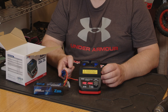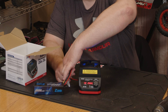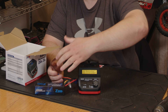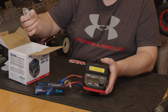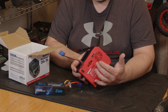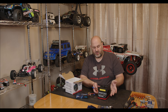In stop mode it'll keep the fan running as long as the battery is connected until it cools down. Once it's cool the fan will switch off, but at any point you can just disconnect the battery because it's not actually doing anything and it'll cool down with room ambient temperature. The other thing you get in the box is a spare 40 amp fuse that goes in the bottom — that's in case you do anything that manages to short it out, or if anything goes wrong internally, the fuse will pop.